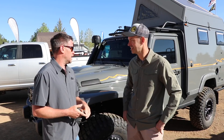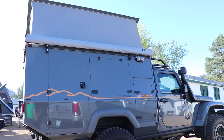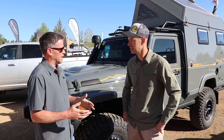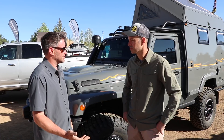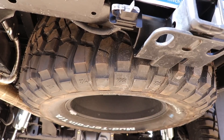For the frame mods, we took our Brute rear extension from our Brute double cab and put that on the back, so the wheelbase is the same — it just has the extension on the back. Overall it's roughly about 11 inches longer than a four-door Wrangler if you count the tire, and about 27 inches longer than a regular Wrangler overall. But effectively it's only 11 inches longer. The spare tire went underneath.